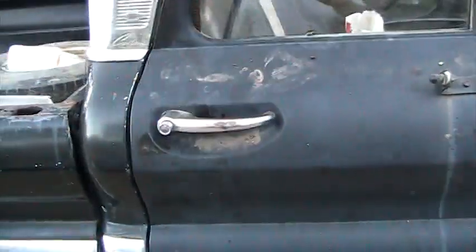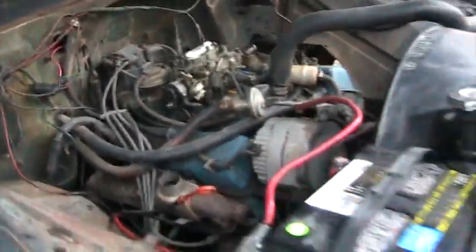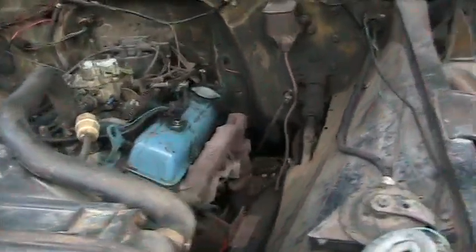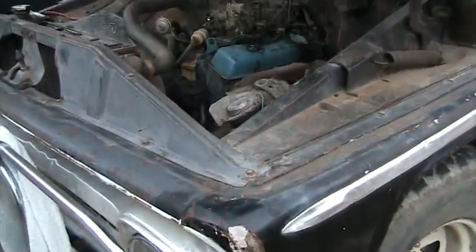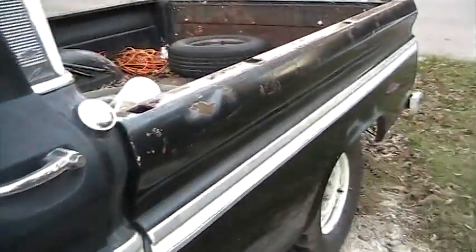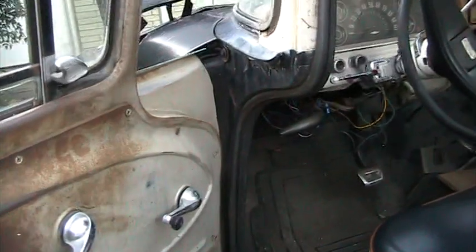Those are the two-ton truck doors. I'll be putting the battery back in — it sure runs good, and that's why we wouldn't want to take a chance on that motor freezing up and cracking on its journey overseas. Something to think about when you're shipping a car: be sure to put plenty of coolant in it even if it's summertime, because it may go somewhere where it's freezing. I don't know for sure what route the boat will take, but anyway, it's about ready to go.